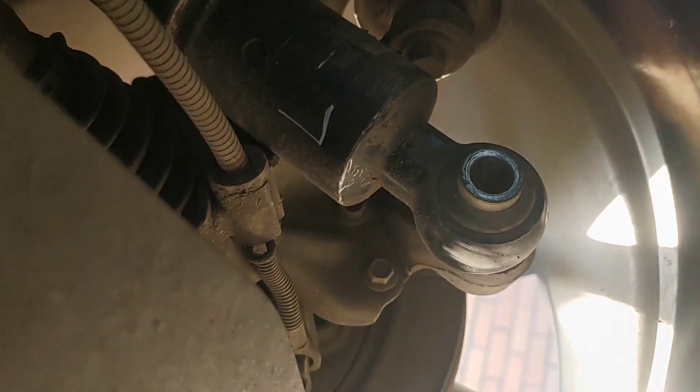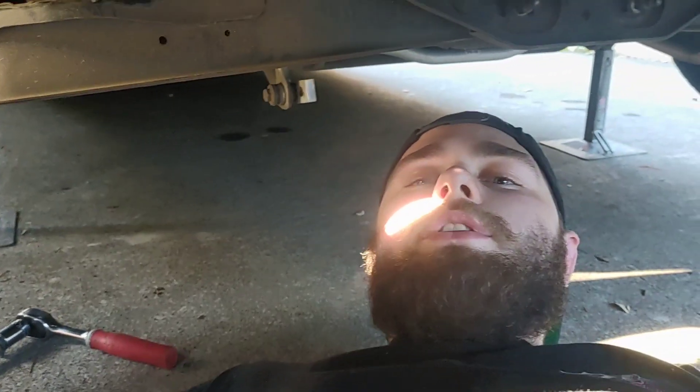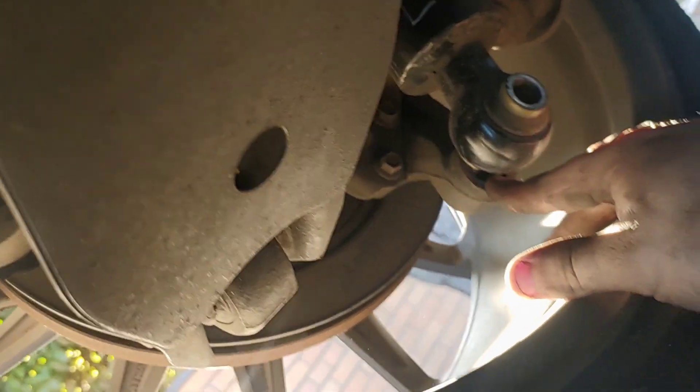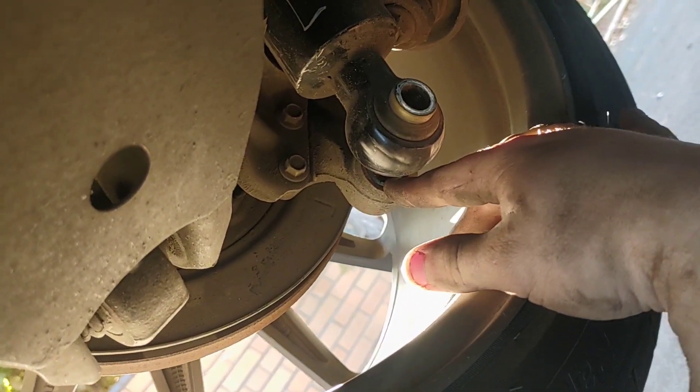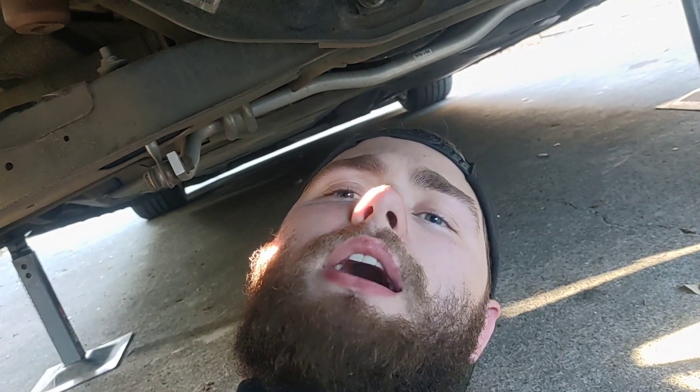I know I said we'd come back when the car was off the ground but I just remembered we still need to bolt the strut itself back onto the car. The easiest way to do that — normally I'll sit a jack under the wheel just there, or some sort of leverage, and jack the wheel up until it locates the shock into the little groove on the knuckle just there. Normally that's enough — you can just throw a bolt back in and she'll be fine.